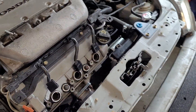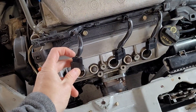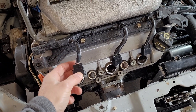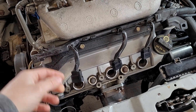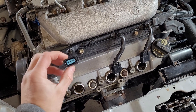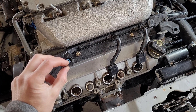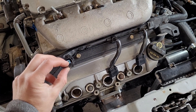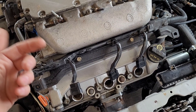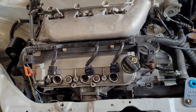It's a Honda, and a lot of the three-wire coil-on-plug setups are the same. It's got a power wire, a ground in the middle, and then the end should be a trigger wire that gets a five-volt signal off of the ECU. You can test that by putting a multimeter probe in the pin for the trigger wire and the other side to ground, then turn on the ECU output and verify you're getting five volts there. You can also test the power and ground — that's the first thing you want to test.